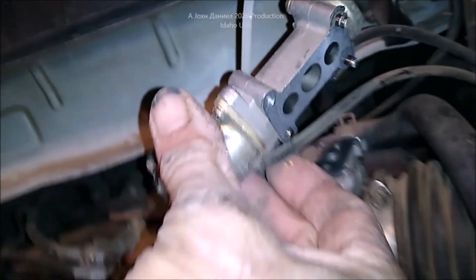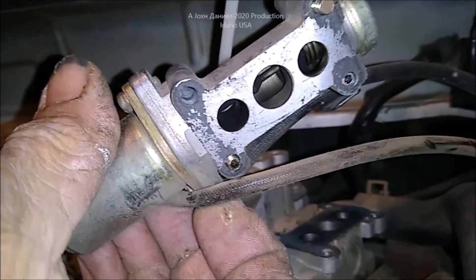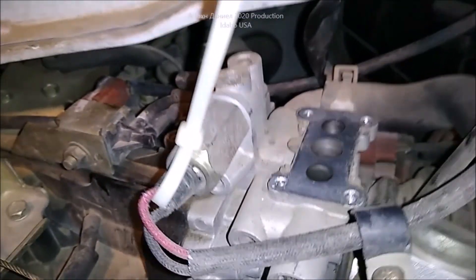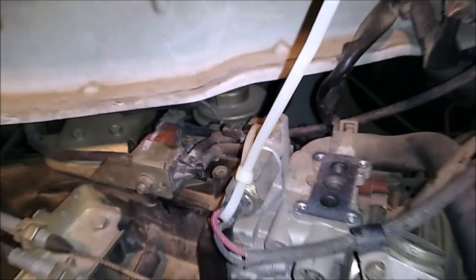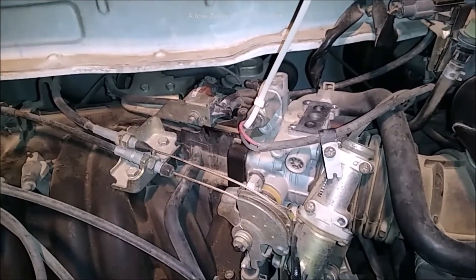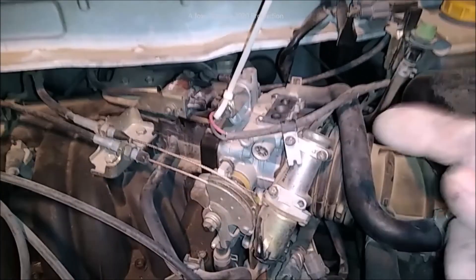When I look underneath it you'll see what I mean — there are the holes. Now you see all that carbon built up in there. We're going to clean the carbon out so this thing can actually move on its own. It allows air up through those two holes and back down into that one to keep your idle — just enough air for your engine to properly idle.